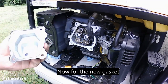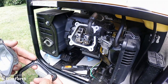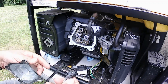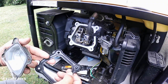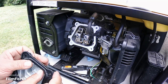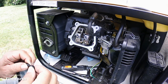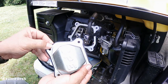Now we've got our cleaned-up valve cover and our brand new gasket, which has a little rim down inside here that sits in this little outside rim. You want this part against the machine — the nice flat side. Everything has its own little grooves that fit into this groove, and the outside sits down in here. So you just put it on there, make sure everything is lined up, and work your gasket around there slowly, because you don't want to be rough with it — it is a pretty tender gasket. Now you can see how it sits right down in its groove all the way around.